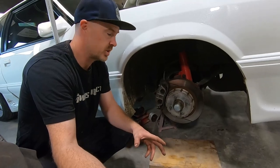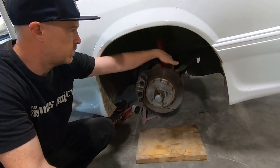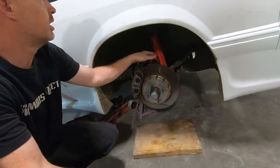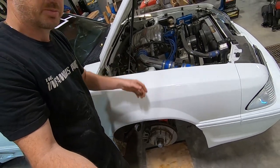Wheels are off. Next up is pretty straightforward — we're going to put the jack underneath the lower control arm to support it, get these two large main bolts for the bottom part of the strut undone, loosen off the top bolt of the strut up here, remove these plates, and swap everything out.